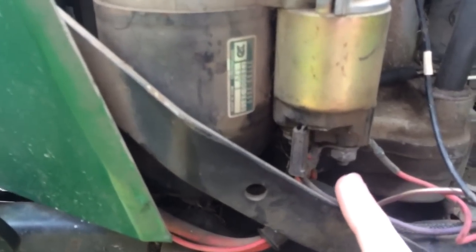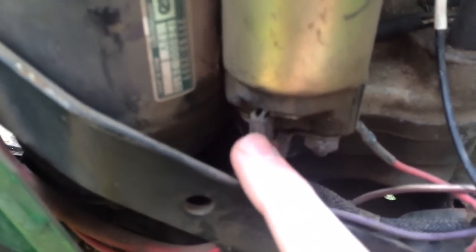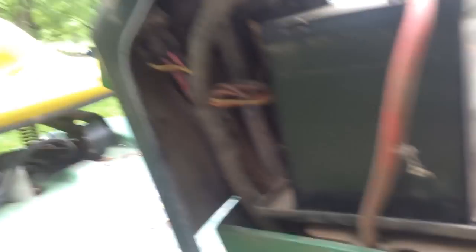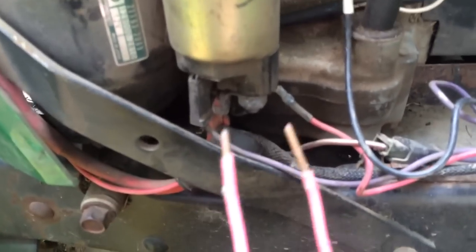This post has the red cable going straight to the battery. This wire on the other post — the smaller purple wire — goes to this relay box and then back up to your ignition switch under here. But that part's not working, so all you need is a piece of wire. It doesn't have to be this thick.